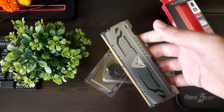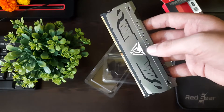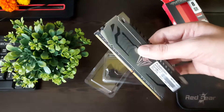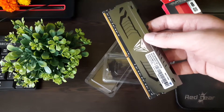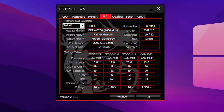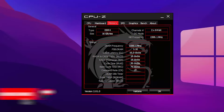I went ahead and installed it and started my system, which was pretty smooth with no blue screens at all. From October, I never had any blue screen or crashing issue during gaming or video processing. I have G.Skill and Patriot both running at 3200 MHz without any problems. If you're in the same situation, make sure you set the timings correctly in the BIOS — the timing rating should match with the RAM you already have. The RAM is running in a 1:1 ratio perfectly fine since it matches the timings.